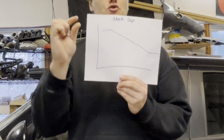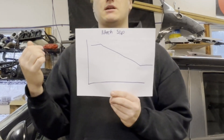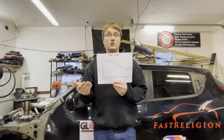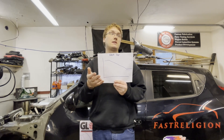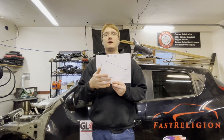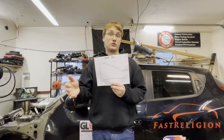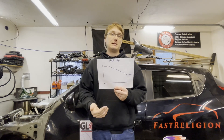This works, but it's extremely touchy. The more the clutch wears, fluid temperatures, how hard you release — a bunch of things can affect how it works. The consistency side is a little bit difficult. A good example is Booster VO: when they were trying to get a world record in the MR2, they had a really hard time dialing in their launch. They'd adjust the clutch slipper and it would do too much or too little, or wouldn't do the same thing the next time around. They constantly battled that.